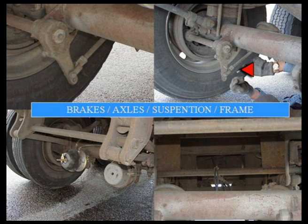This device up here, that's a normal position in an applied position. This was actually when it was in non-applied. So when they applied it, this is the angle we got in that. What that tells us right off the bat, and you should have been able to see it in a walk-around, is that brake is not adjusted right.